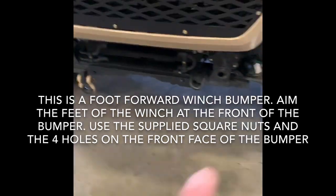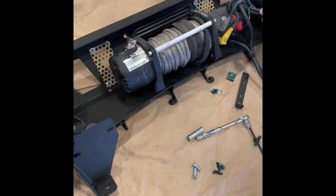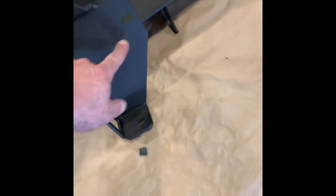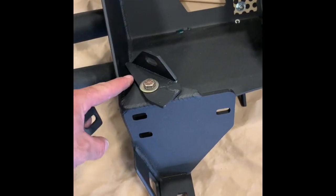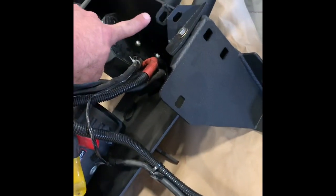The factory bumper is cut off and the new bumper is sitting on a pallet. We're getting the winch set up — triangular frame brackets are hand-tight so we can get the four post studs in, then tighten down to the body mount. We're mounting the solenoid on the solenoid mount. In your kit you'll see this bracket and two triangular brackets — you know they're in the right place by matching the triangle to the triangle underneath. The solenoid bracket goes to the tab on the passenger side.